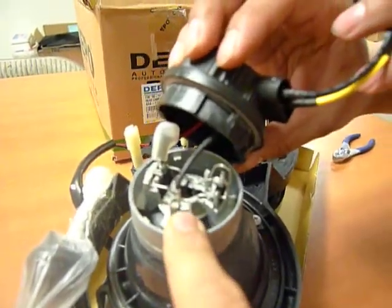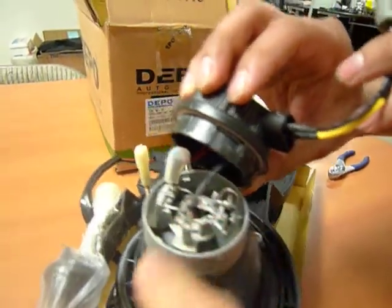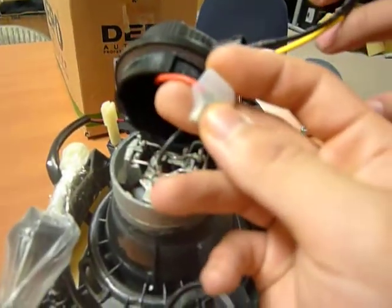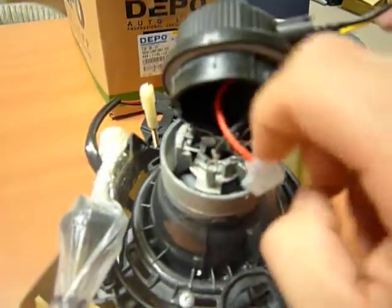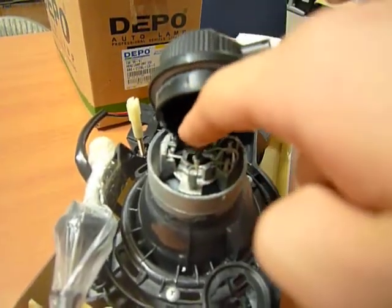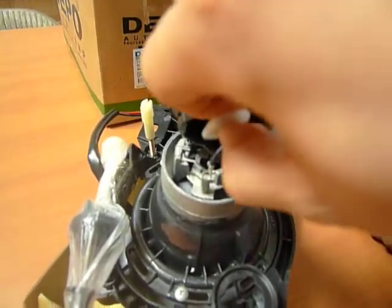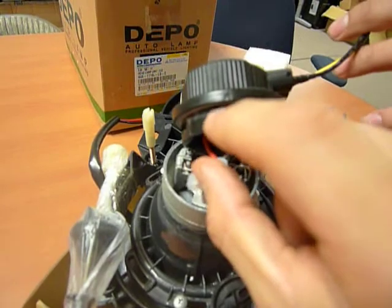You re-seat that and that pretty much grounds the grounding negative. And conversely, this will be your positive to power the halogen bulb. So if you have a halogen bulb already inserted onto the projector or even the high beam spot, what you're going to be doing is inserting this back to the halogen bulb pin that's left open on top.